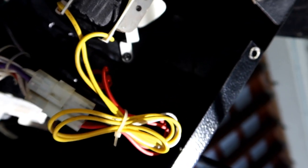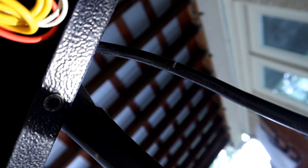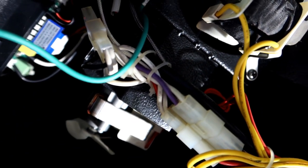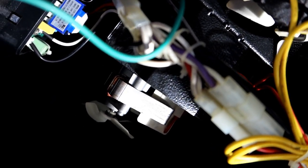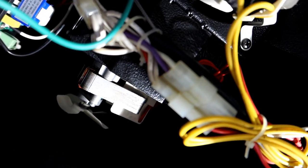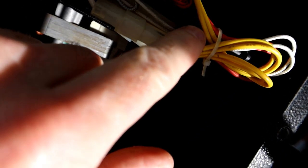Now unfortunately this isn't going to be as easy as I'd hoped, because the power cord goes through the wall in the back of the barbecue and up into this transformer. I'd have to take that transformer apart to get in there and replace the cord properly — you want to connect right on to the terminals. So we're going to do a slightly different approach. Basically, I'm going to cut the cord here and then graft the new cord on to the old cord.